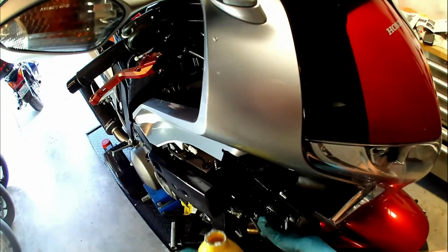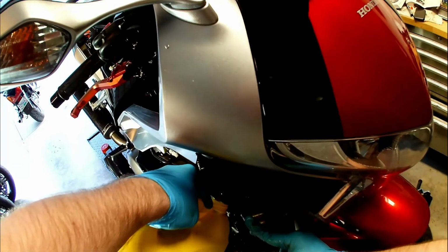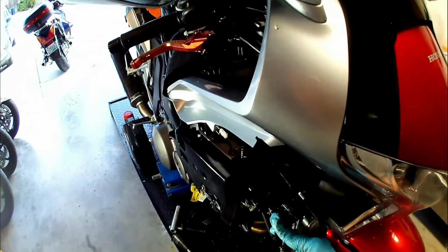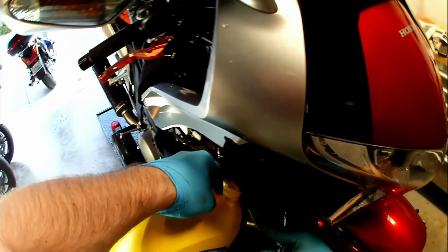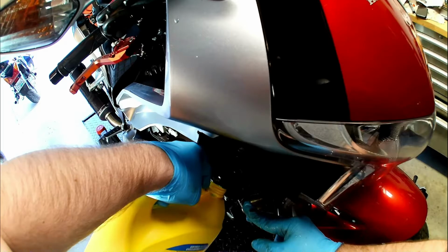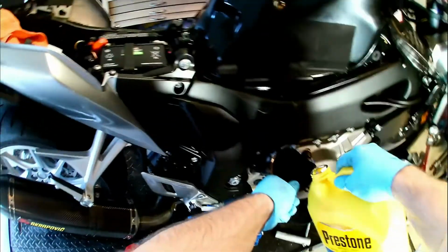A tedious job on this motorcycle since the air in the system seems to come up slowly as the coolant fills the system. Take your time, let the coolant work its way through the system, and continually add more. It's a good idea to have a catch bucket under the bike while filling the radiator. You'll spill a lot getting it into that narrow radiator fill hole.